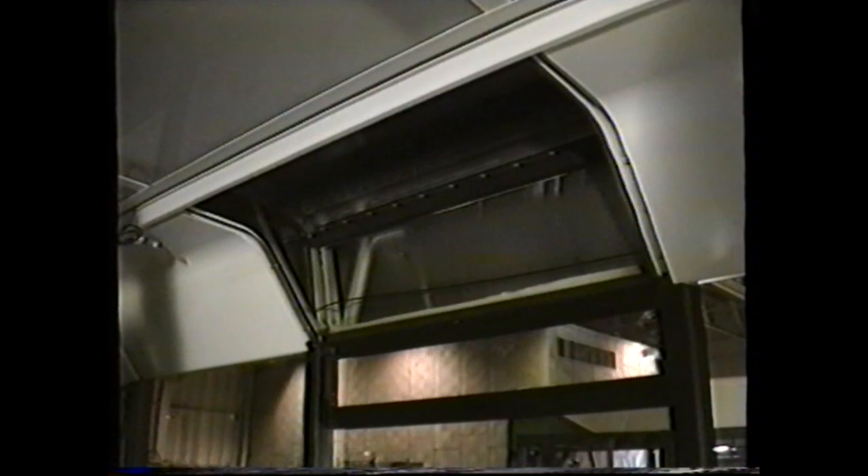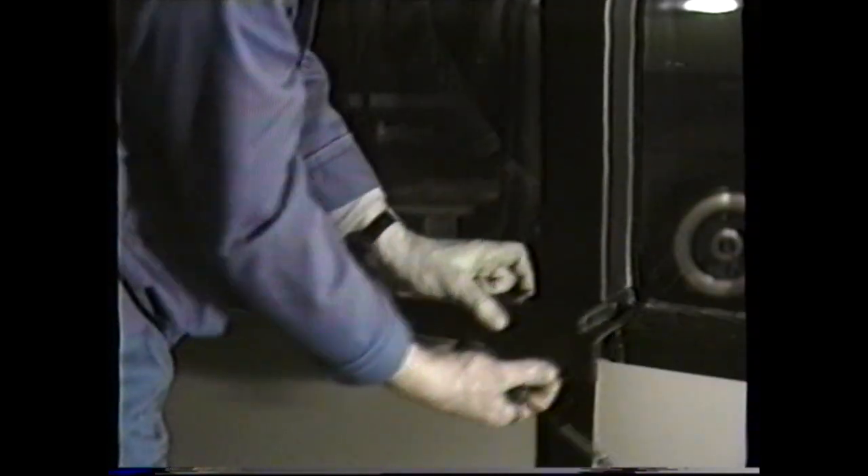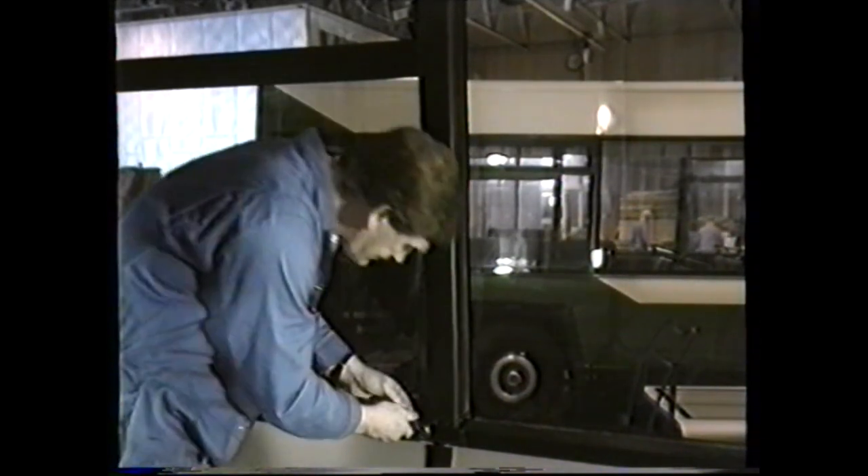Let's first of all look at the window removal and replacement. First, it'll be necessary to remove the roof panel immediately above the window. And before removing the panel, remove the anti-rattle rubber strip. Next, remove the two cappings at the bottom of each of the pillars. Then, release the 10mm nuts at the top and bottom of each pillar.